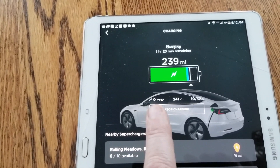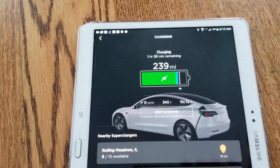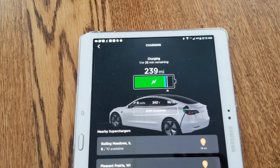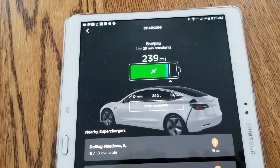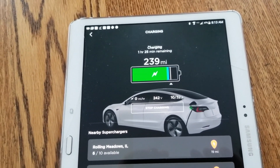That's 2,410 watts of power going into the system, but the battery is really not charging — only a tiny trickle. So that 10 amps at 242 volts is purely being devoted to warming the battery right now. That's the rate at which the battery warms itself to precondition for charging, and it's been pretty consistent at 10 amps at around 240 volts.